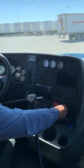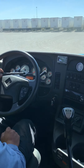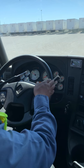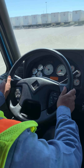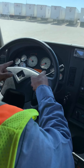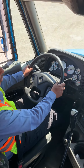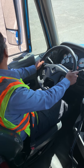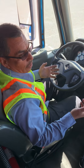Now I'm gonna release both the parking brakes and trailer brakes. The chocks are removed so I can go forward. At this time we can check the speedometer — I'm going to go about five miles per hour. I'm going to hold the steering wheel lightly and step on the clutch and brake at the same time. The steering wheel should not pull to the right or left, and we're checking the service brakes. My steering wheel didn't pull right or left, so the service brakes are working properly. I'm going to back up to the same spot — put the transmission in neutral, set the parking brakes, and this concludes my pre-trip inspection.